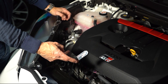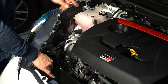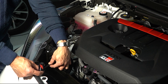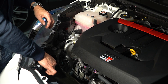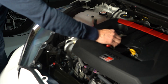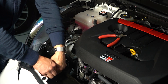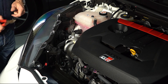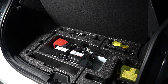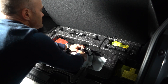I've got the JB4 connect Bluetooth connect kit. They recommend that it faces the cab of the car, so I'm actually going to zip tie it to the loom where the airflow sensors go to, allowing it to sit there so it's quite easy and visible to the car. I've got the cutters to trim the zip tie. That's it all installed. Now to reconnect the battery and start the car up to ensure that it works — reconnect the battery terminal, nice and tight.